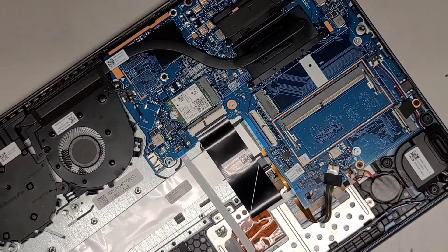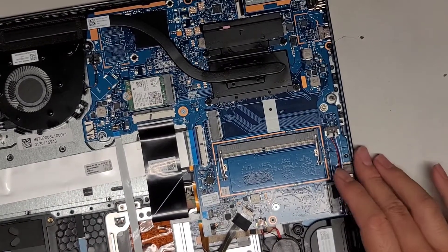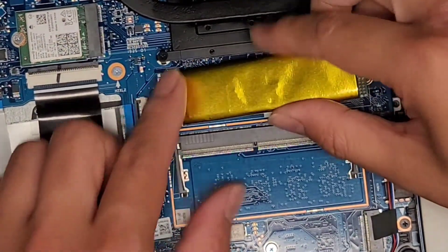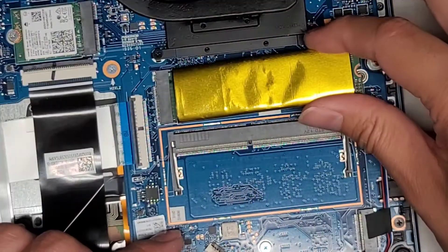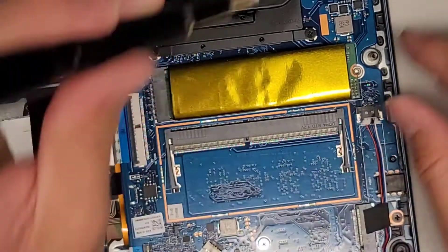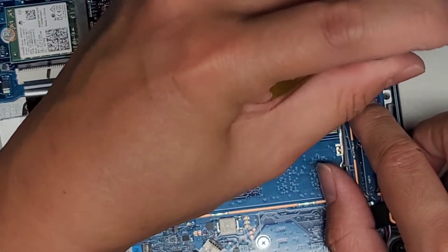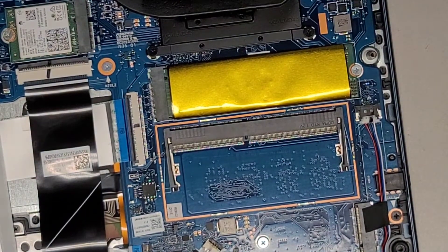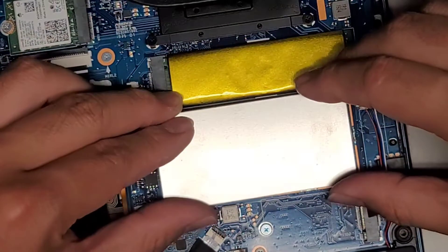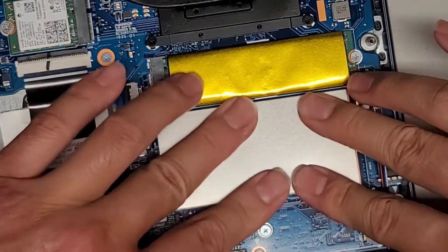Actually let's put back the RAM and the SSD first. We got the SSD — go in at an angle like this, make sure it's in all the way, and then it goes down. Kind of weird that this slot doesn't really click like usual. We'll get this screw in. Then we got the RAM stick — goes in at an angle and then click it down. Put this metal box back — make sure to line up the edges with the little parts that catch and hold it into place, then push it down and it will stay there.